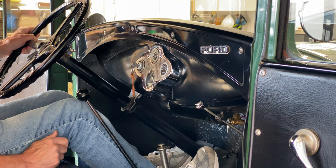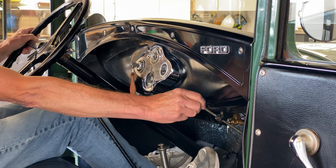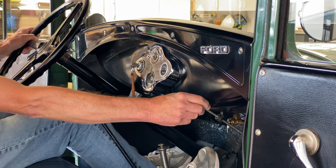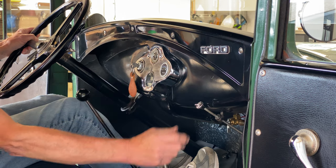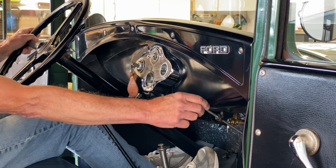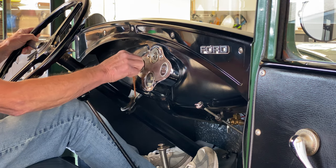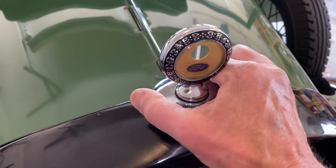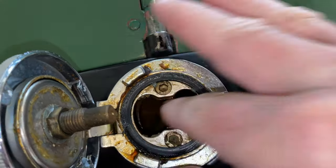I had to advance the spark — it was turned up too high. Pull the choke out a little bit, keeps it going, that's warming up. It doesn't twist to stay on; it's a spring-loaded choke — I think it's not too efficient. It's running good now though. I'm going to check the radiator to make sure it's still full of vinegar. I can still reach it. Let's let it run a little longer.